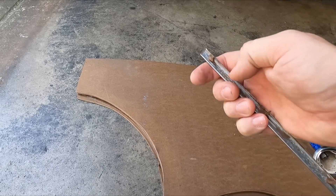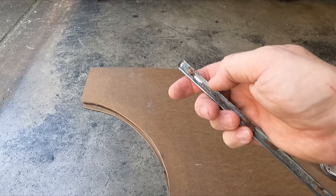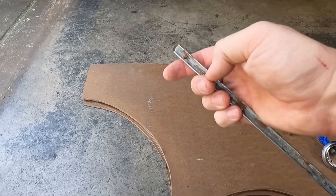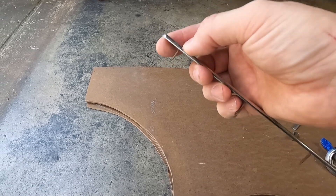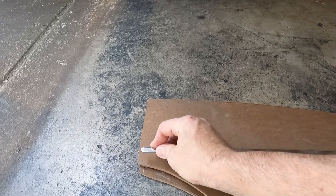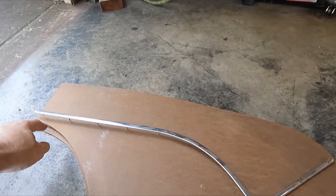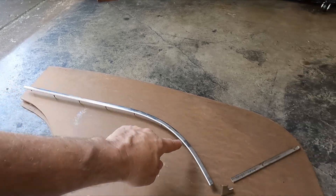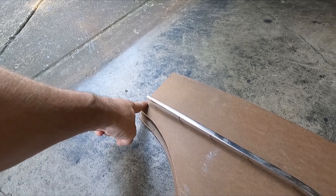It would take quite a bit of metal shaping to do. Some of them have inserts pressed into them in the back, some do not, but this one actually does. So it would be very difficult to try to reshape that back around just by metalworking it. So what I'm going to try to do is cheat it and use existing round ends — put it this way so I have a rounded corner at the very back.